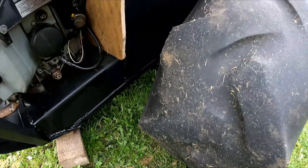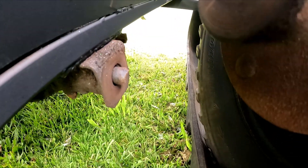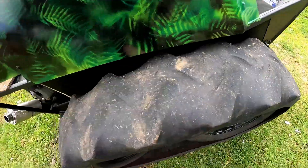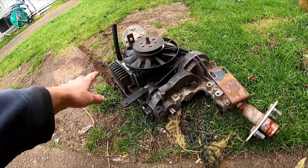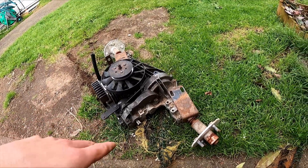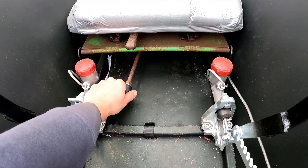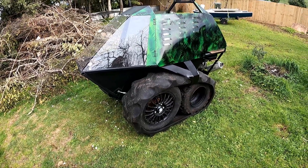It looks cool right? Everything works - you'd think so. I had this awesome idea to take it to work and everyone can have a go after work, and it'd be the best video ever. But look what happened - it's held up by blocks because the axle snapped. I was just driving around getting ready to put it on the trailer and we sheared through the axle. The brake calipers were scraping on the rim, it was really labouring. I'd forgotten to put the track support on this side, so as the track started walking off it loaded it up so hard that it snapped the axle. Sean from the mower shop gave me a hydrostatic one - there's a lever to go faster and slower but there's something wrong with it. I might end up using it because it was a real pain to shift gears on the other gearbox - you had to switch the motor off just to shift. You'd have to turn the motor off to switch from forward to reverse because if there's any load at all on the belt it won't shift. The whole purpose of it was for my kids to drive and I ended up making it too hard for them, so the automatic might be the go.